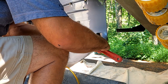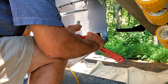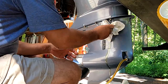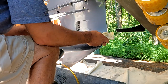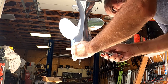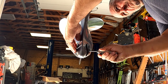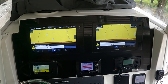I'm not putting a lot of torque on these — I'm just trying not to slip off and booger up the threads. Make sure you wipe down the lower end real good, and then just put the cover back on. Last thing we have to do is reset the maintenance indicator.